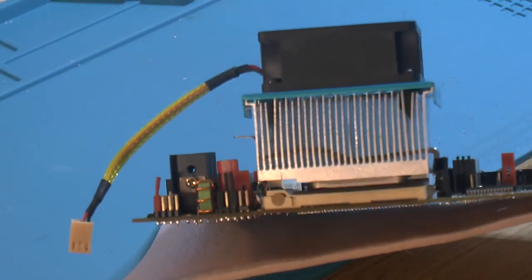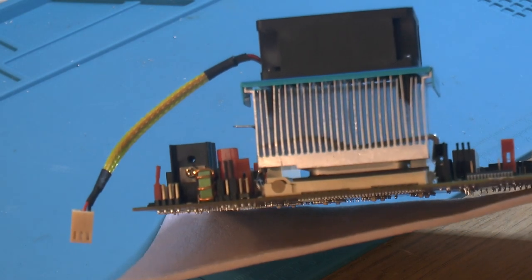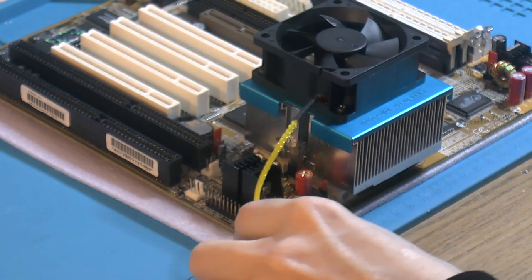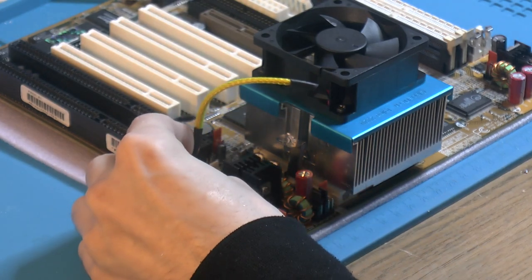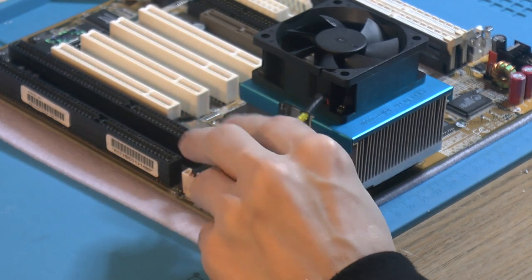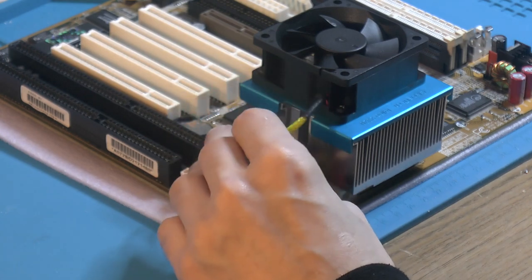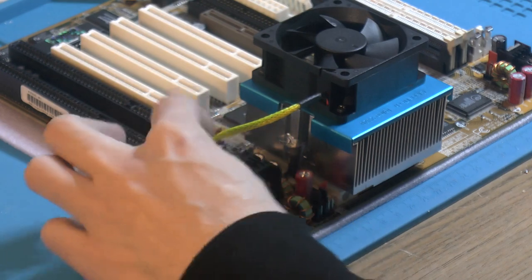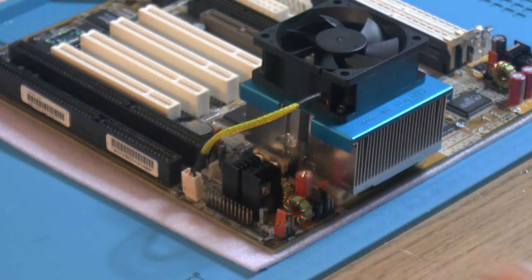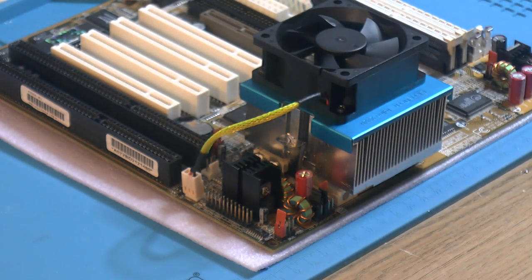Here you can see how tall the IHS is — your ordinary cooler won't work without modification. The fan header is down here for the CPU. This board has some kind of weird fan control — when a program probes for sensors, which it doesn't seem to have in the traditional sense, at least that fan header over here goes to 5 volts, which stops the fan. That's not good, so I'm going to use the actual CPU fan header instead.